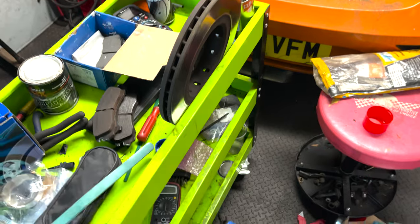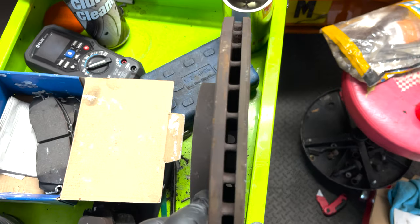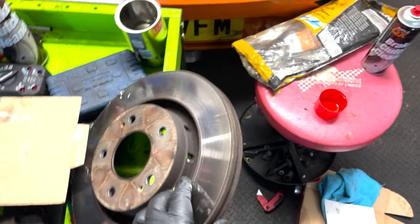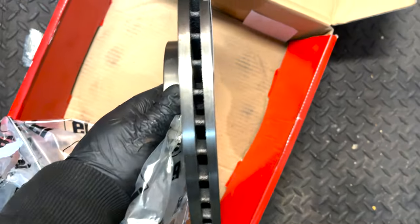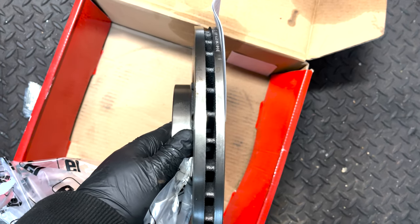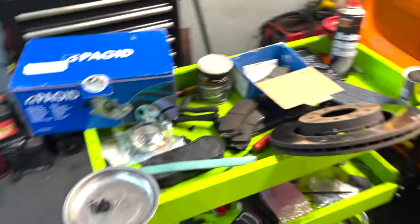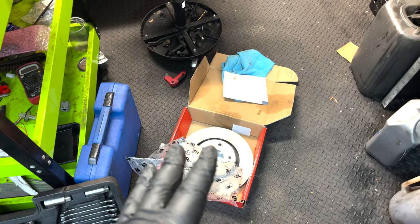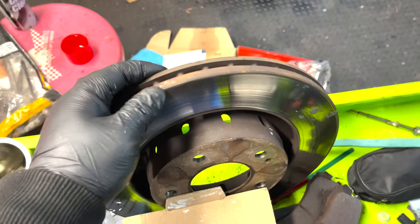On the right front I found something interesting - can you see the disc? The inner side is a lot thinner than the outside. I don't know if you can focus on that, but it's very visible. Anyway, I ordered some discs because I thought this is not right. But then I got a new disc and as you can see, that's actually a normal thing - the inside of the disc is thinner than the outside on this car. So I put the pads on the right hand side with the old disc, because it's not worn at all. There's a tiny lip on it but there's plenty of life left.